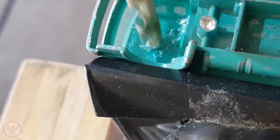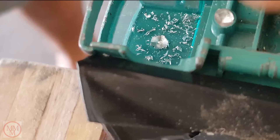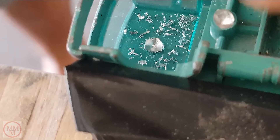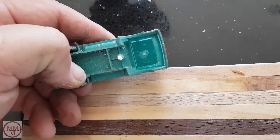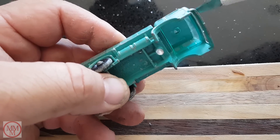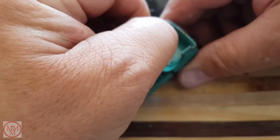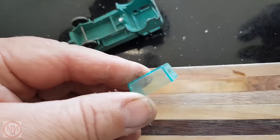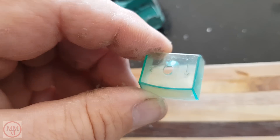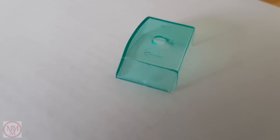Try not to drill through the roof of the cabin. Now that I have drilled that rivet out, I use a small blade to dislodge the windscreen. Here's the windscreen — it's looking a bit dirty, so I shall clean it up with some washing up liquid and warm water. Here's the windscreen after I've washed it and it's not looking too bad at all.